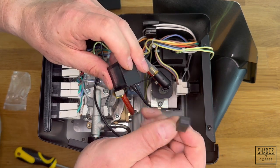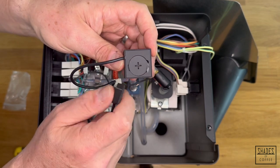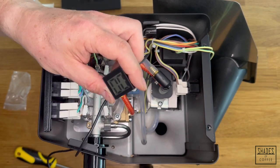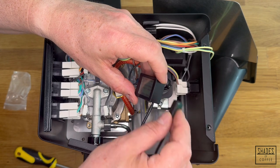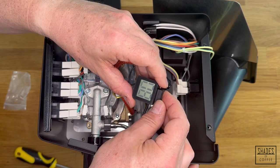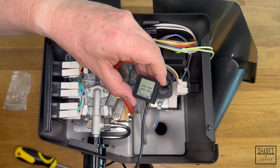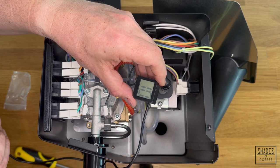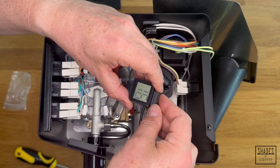The Krona Cube sensor detects magnetism. It won't work to start with because we include a small tab covering the battery contacts — the very first thing you do is remove that small tab. The Krona Cube will now work and display '00' when first powered up. Apply the sensor to the magnets on the top, bottom, or side of the device and it'll start counting. Take the sensor away and it'll stop. Within 20 seconds it will turn off, reset, and sit idle with a blank screen. If you resume within that 20-second period, it'll resume counting from where it left off.